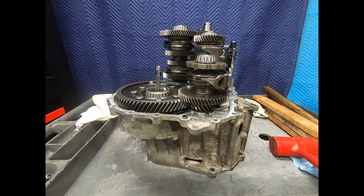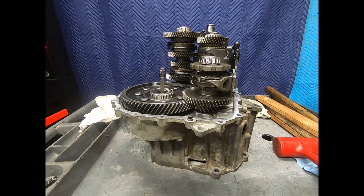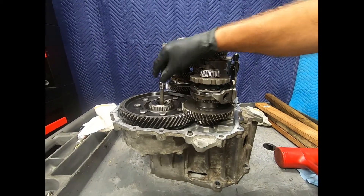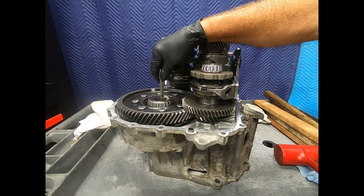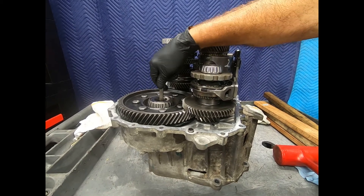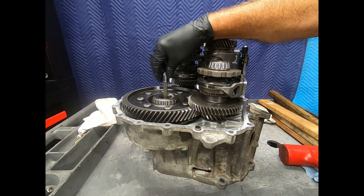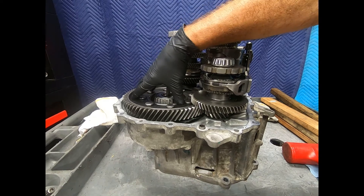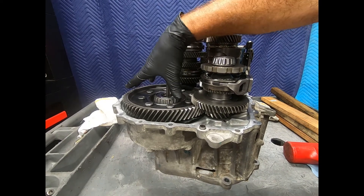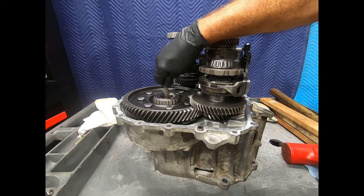We're not actually showing the assembly of the seven-speed gearbox because it is rather cumbersome and difficult. A couple of clues: one is that the differential side gears are going to have a tendency to shift around, so be sure and put the bolt back. Be careful because if a side gear is off to the side it will have a tendency to jam as it goes back into the case, so make sure it's centered correctly.